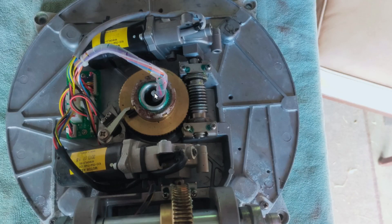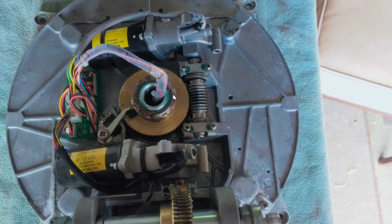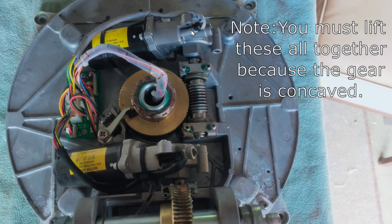Be careful when doing that so you don't damage the cables. The next thing to do is push out the split pins — there's one here and another one on the other side. Then I applied some heat to the Loctite on this nut. I did try to undo it without heat and it was pretty tight, so I didn't want to force it. I didn't have the right tool for this nut so I was using multi-grips, but once I applied some heat it loosened up nicely. I used a small blow torch and it worked a treat — just be careful not to get too much heat onto the motors. Then remove the four Phillips head screws and lift the covers off.